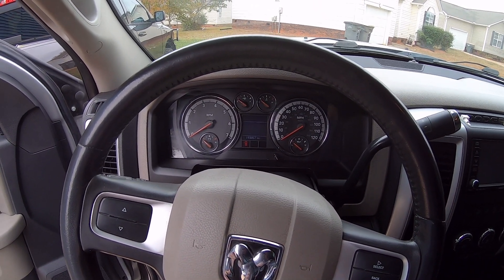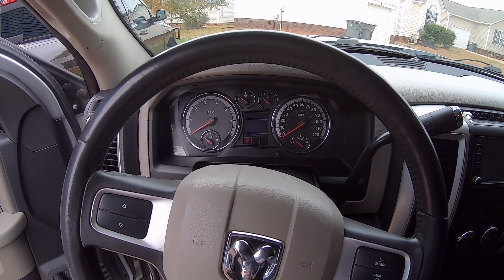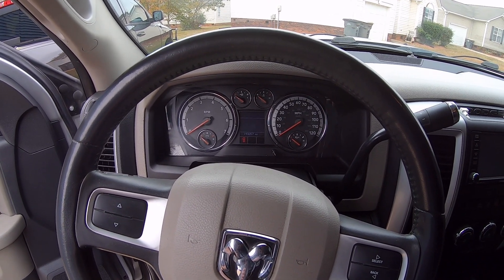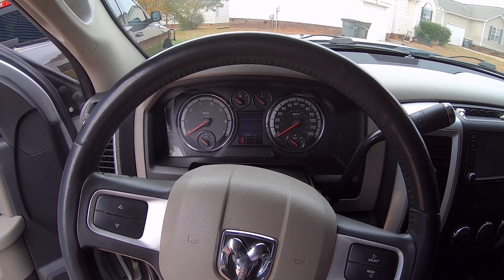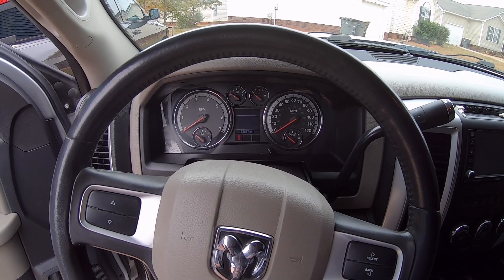I should have reset this when I got fuel, but I'm used to everything being on the steering wheel rather than the little button. We've probably put about 100 miles on this since the first startup and engine rebuild was done, so we've got about another 400 to go. I'll use the trip counter to keep track of that, and once we hit that 500-mile point we'll give everything a once over - fresh engine oil, a new Wix filter, and a new air filter.